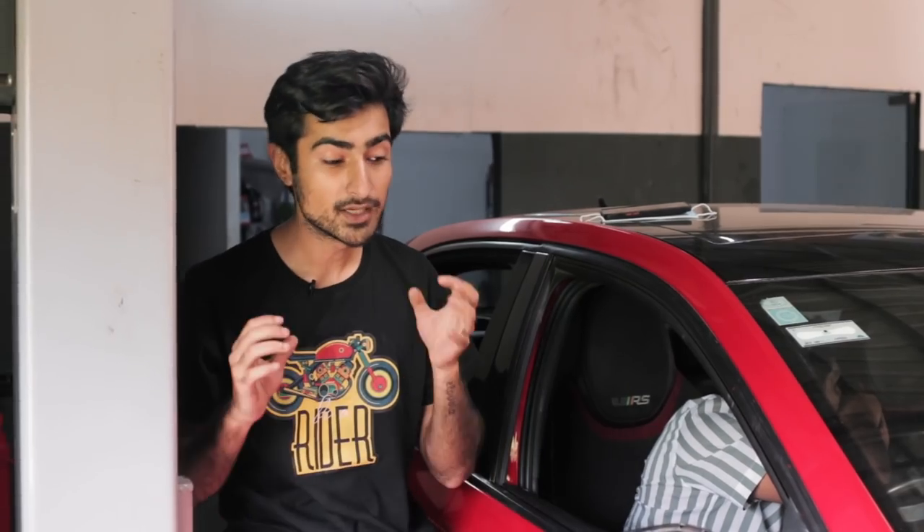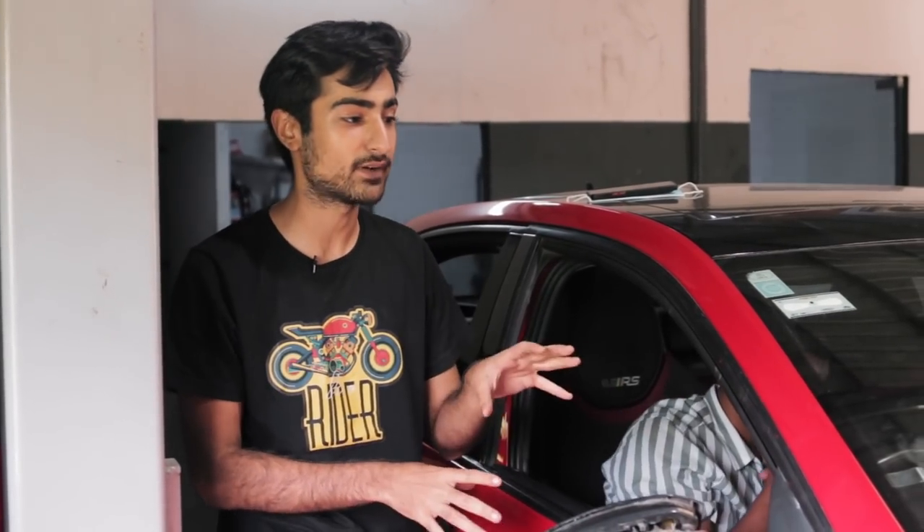We are almost done with all of the performance parts and fitment. We are now flashing the ECU with a base file — we have saved the stock file to our drive and are flashing the tune in. We are doing it a bit differently this time because we are going to be putting the car on a dyno, which is another episode, so stay tuned. We are putting in a base stage 2 file now, and all of the fine-tuning changes can be done during the dyno runs. After the ECU flash we moved on to the TCU flash as well, and that's all done.